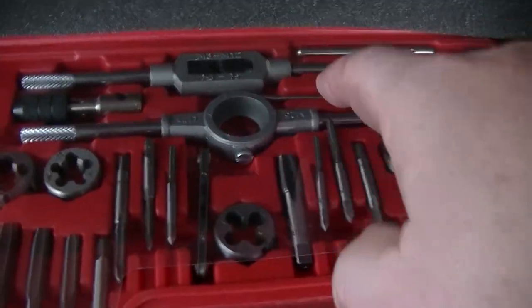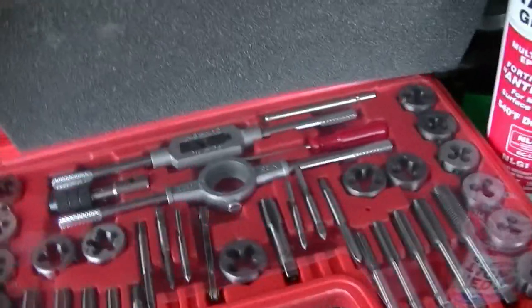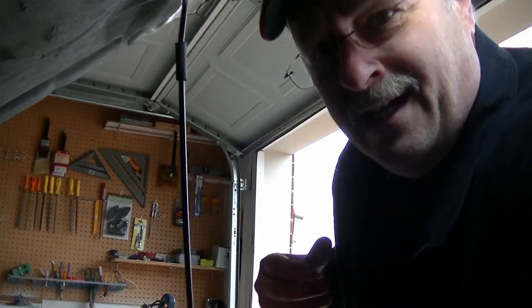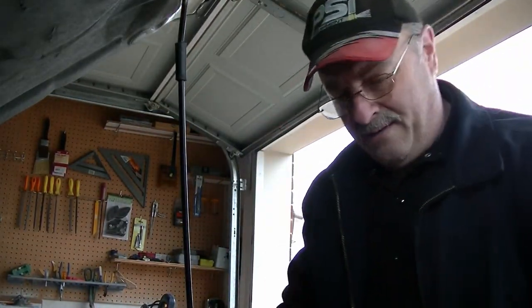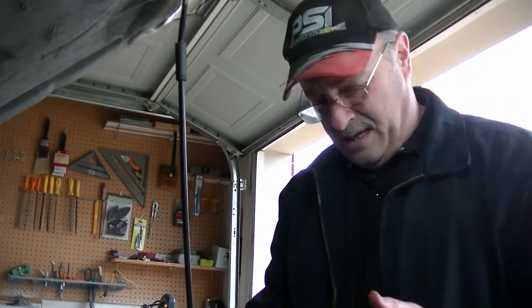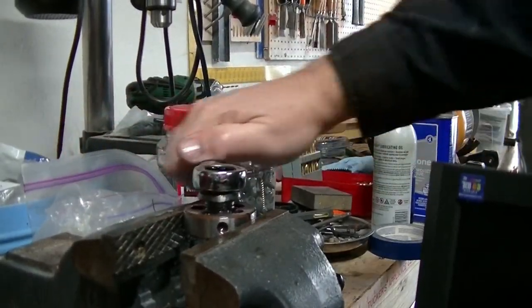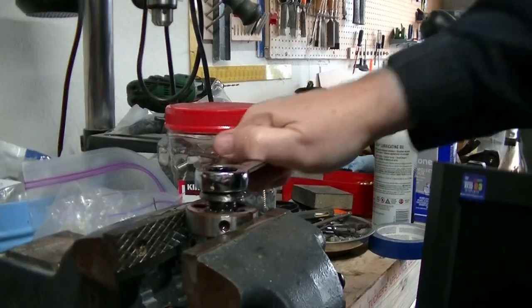Okay, and that's for the tapper there. So I'm going to have to use the vise. I don't have a choice. I'm going to have to feel confident that this die, whatever it's made out of, is pretty strong, stronger than the bolt I would imagine, to cut the bolt so that I don't end up crushing the diameter or anything. That would be terrible. But wow, it looks like it's really cleaning up those threads. Let's keep doing that. It's going in pretty good. I'm thinking this could just go in without the tap once I'm done with this.